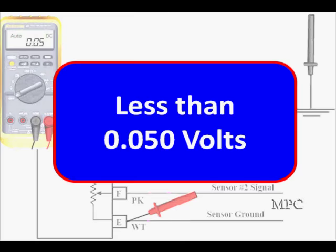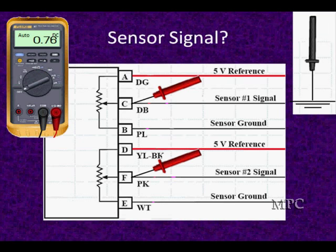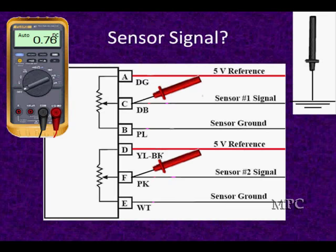Don't always count on seeing 1.2 volts — that's going to go bad, yes, but the 1.2 volts may not be there all the time. Here's what a system looked like when we put our scope on there: our zero voltage getting low — 0.76 volts, which is 760 millivolts. We can't get down to the half volt. Our zero in this case is 0.76 volts, and we get the same thing if we use a voltmeter. We can't get low enough because our ground is bad.